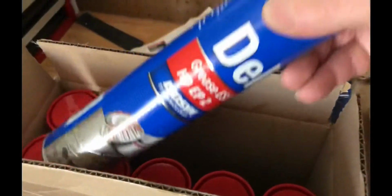As for the grease I used, well, the first time I did it, I just went to the local RV dealer, actually the place where I bought the RV from, and I went to their parts department and I just asked what they use in their service department when they repack the wheel bearings, and I got the same grease that they use. I actually bought it from them, and it was Chevron Delo high temperature grease. So that's what I use this time, except I got a little bit different one. This is like the heavy duty high temperature grease, and I think anything rated for high temperature, extreme pressure to be used in wheel bearings is going to be adequate.